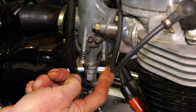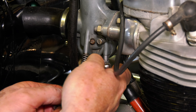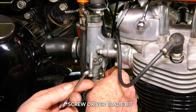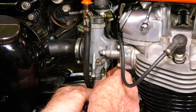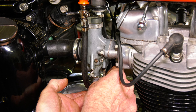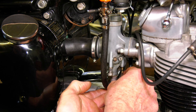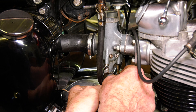Now we've got the main jet assembly back in place. We're just going to take out the pilot jet. This outer nut comes off and underneath there is the actual jet itself. Now we've got to take out the jet itself. It's easy to use a torque drive out of a little socket set which has got a screwdriver straight blade, and a small ring spanner. Hold it up and just crack that off — it won't be tight, just pinched because it's brass. It shouldn't be over-tightened. As you can see now we're unscrewing. There is a fibre washer which you don't want to lose. Just keep your finger on the bottom of your screwdriver bit — it's easier. Unscrew it and then the assembly comes out.